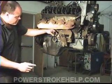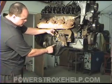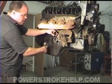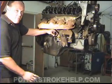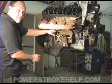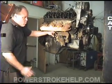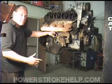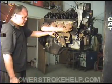I've actually seen some trucks come in that were repaired somewhere else where they took a welder — a torch — and cut a hole inside the pan and re-welded it, because you can't remove the oil pan off of the truck with a motor in the truck. It's impossible. In vans it's even worse — there's no way to get the oil pan off because the crossmember rides right there. It's absolutely impossible; you would drive yourself crazy.